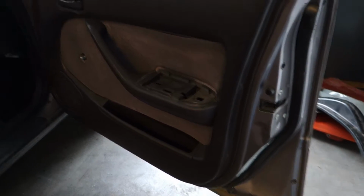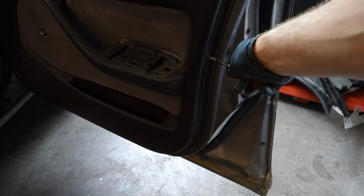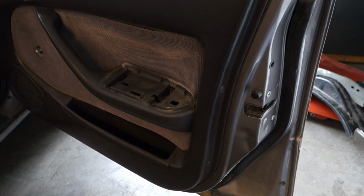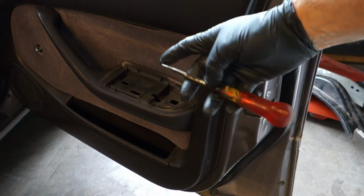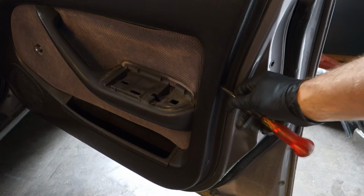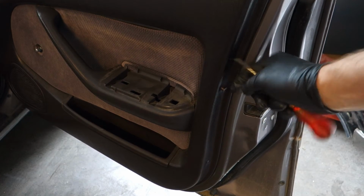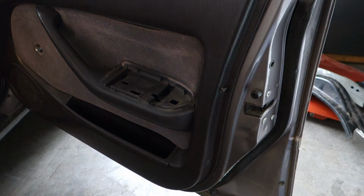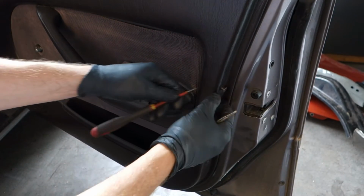Okay, and then this job continues so that I need to look in these areas in here. And there we have small plastic specific fastener, and we need tool where is sharp spike, and when I insert that my thing in here and I press that in, this thing opens, and then I pull out this fastener, and if we have flat screwdriver head, it is more easier.